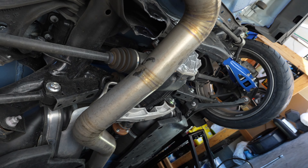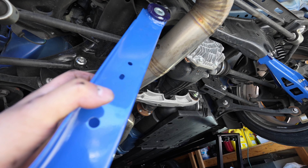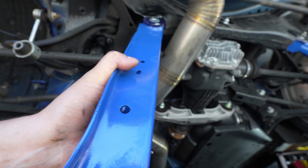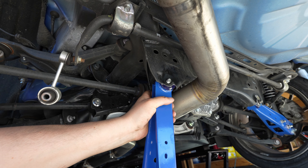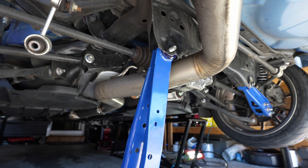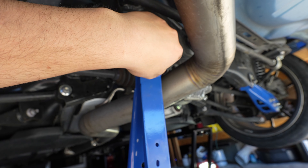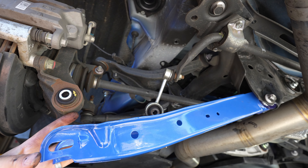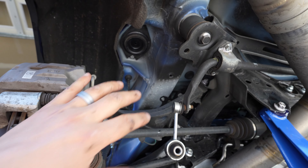You're going to want to clean the mating surfaces of the subframe. I went ahead and greased the polyurethane bushings as well because these are going to need to move. Use all the OEM supplied hardware to attach this — the only part that's different is on the knuckle, which I'll show you when we get to it. Now we can fold this up and line up the strut to the bottom before we tighten it down up top.